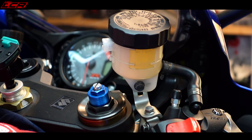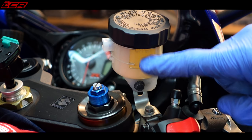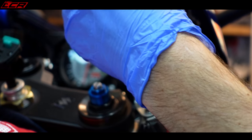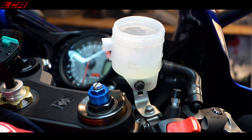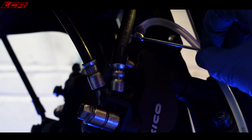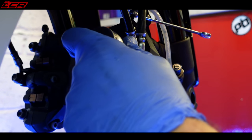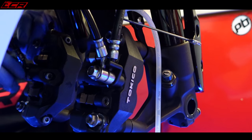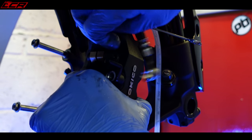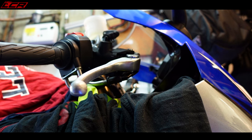Because all the lines are going to be coming off and there's going to be fluid going everywhere, what I'm going to do is suck out the fluid in the reservoir — not by hand, but with a syringe. That gets the most possible out of the system. I'm going to use my big syringe and suck it out. Look at that — that saves a lot of pumping. Bleeding hose on. The line's off. I've got the new line prepped and ready to feed back on to the master cylinder.